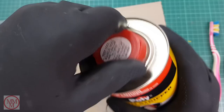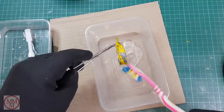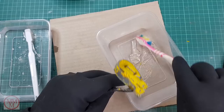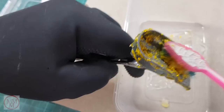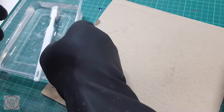Now the gloves are back on and I'm going to remove the paint off the trailer. I didn't want to use paint stripper on the motorbike because it would have chewed up the tyres. I could have used caustic soda on the trailer, but honestly I don't actually like using caustic soda — it's chemicals, there are gases coming off, if you spill it it burns you, and the glass has shattered on me twice. It's a little bit risky. Each to their own — there are risks involved with paint stripper too, it is caustic and can burn, but it's easier to clean up afterwards and doesn't spread everywhere if you have a catastrophe.